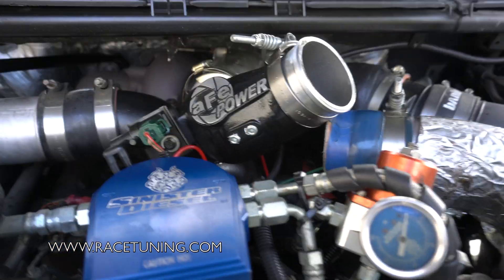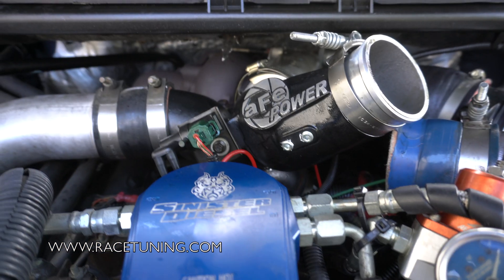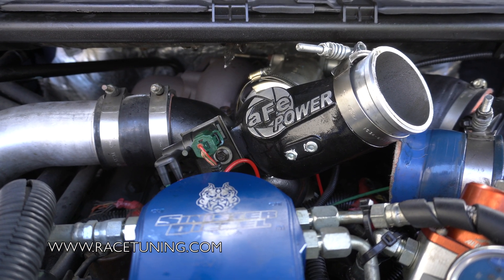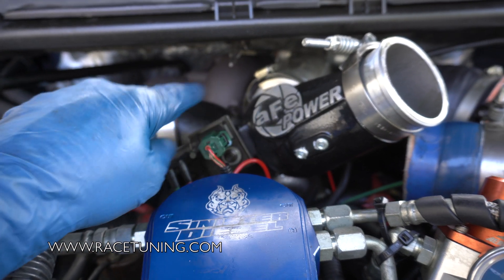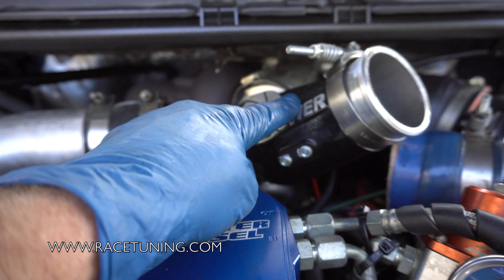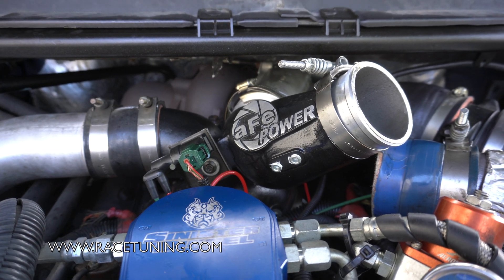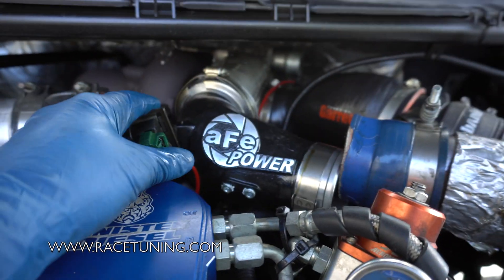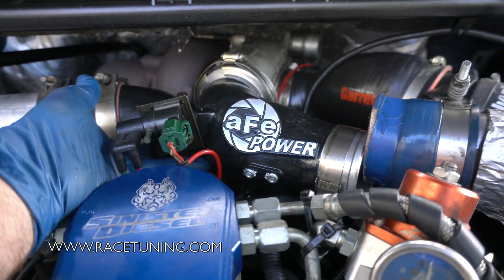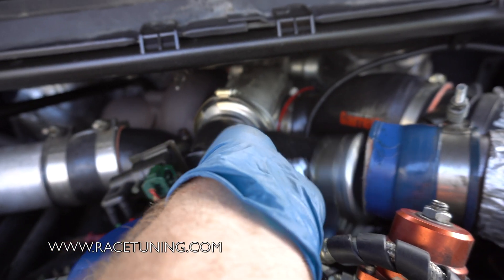When I first installed it — here's the upper that goes down the cold side — it never did fit right to begin with. The whole objective of this thing is to keep the two parts separate because the original manifold is a one-piece design. They say the heat from the exhaust side will migrate to the intake side and give you a hotter intake charge. The main problem upon initial installation was that I actually had to grind the underside because it was hitting the exhaust in order to get it down as low as it is right now.